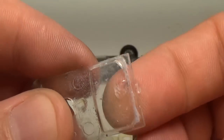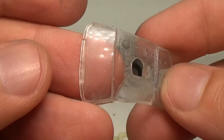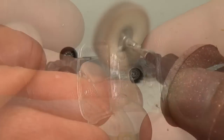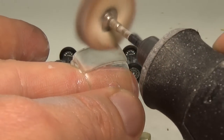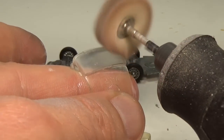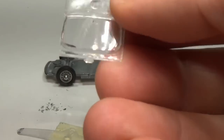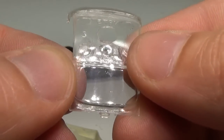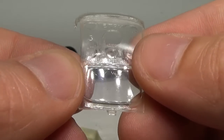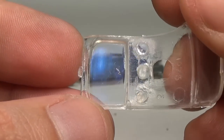Next I want to work on the windshield. It's in pretty good shape besides being dirty with some small scratches. I'll remove these using a polishing wheel and polishing compound. Care must be taken not to polish in one area too long as it can heat up and warp the plastic. Here's how the windshield turned out when I was done — the polishing wheel makes this process very simple and fast. You'll notice in the back window a dark spot; this was an impurity that must have been introduced when the window was cast. I find a lot of these in older castings and sometimes in modern ones — there's really nothing you can do about them.